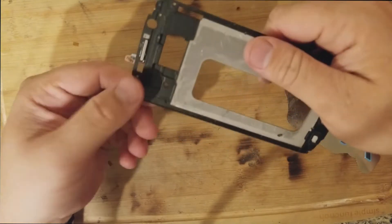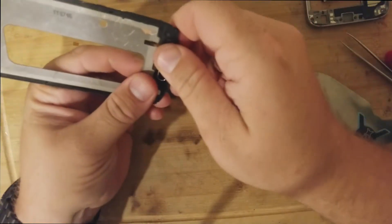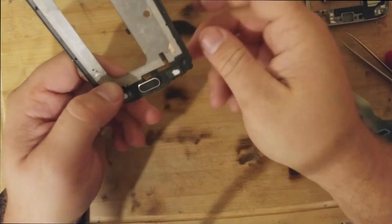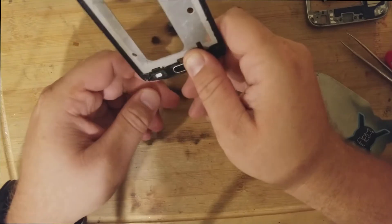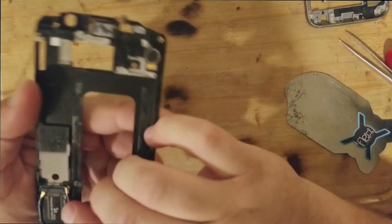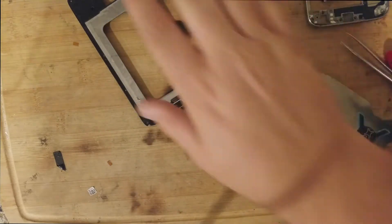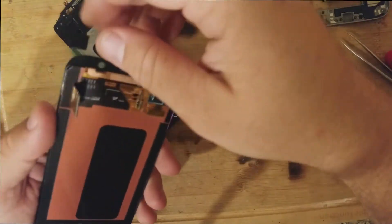Watch out for this piece up here — it loves to fall off, very irritating. Make sure you just rub off the old adhesive with your finger; it should just all rub off. And then there's no glass anywhere, especially if you're tearing off a broken LCD. If you want to see how to do actual glass repair, I have some videos — I do not recommend it; it should only be done by a professional. I stopped doing glass repair after the Galaxy S7 Edge and S7; they just got too challenging. Make sure you get the correct charge port. This one says G920A for AT&T; the T-Mobile one will work for that; Verizon and Sprint ones will work for those. Make sure you get the correct part if you break those, or maybe even buy another one just in case you do break it during this repair — those are pretty easy to cut, and then you'd lose your functions.